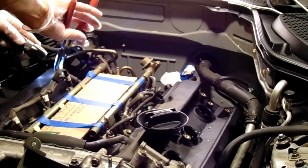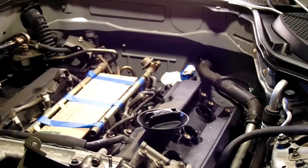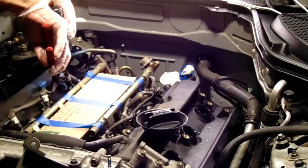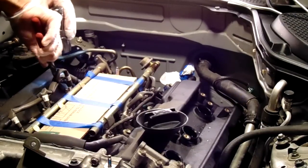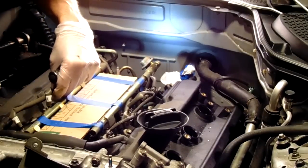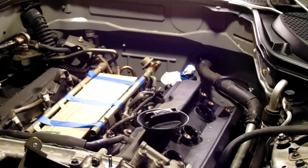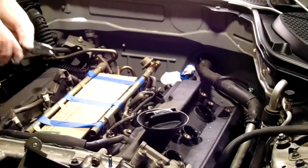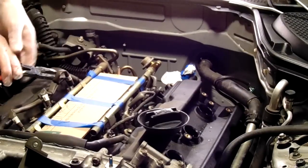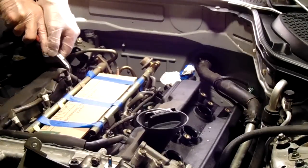That wiring harness goes to the fuel rail. You have to disconnect the fuel rail wiring harness from the valve cover with a pair of needle nose pliers, then you can zip tie it out of the way to the rail. You need some clearance once you disconnect it — pull it back a little bit. The easiest way is to release them from the clip. Not too hard.